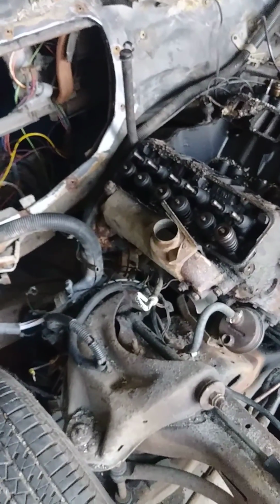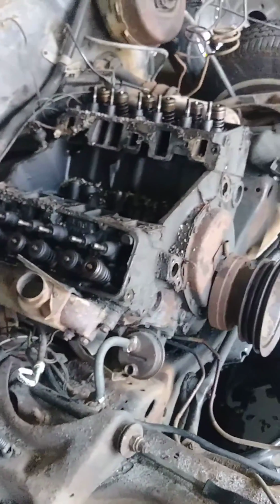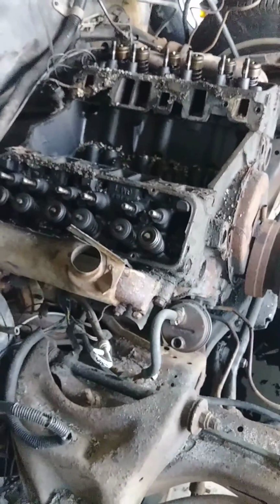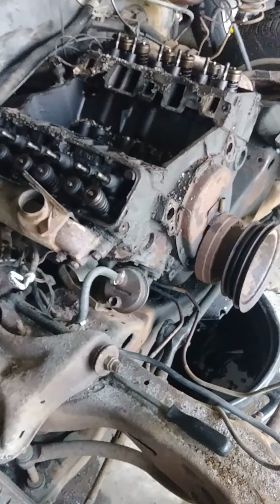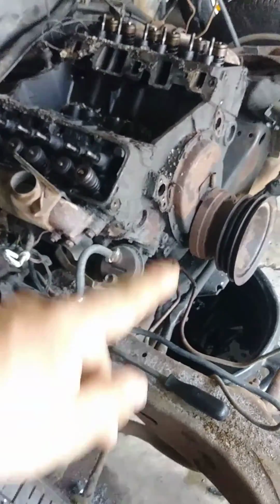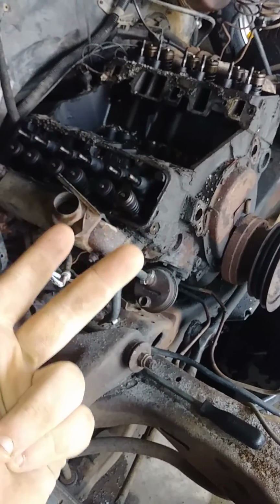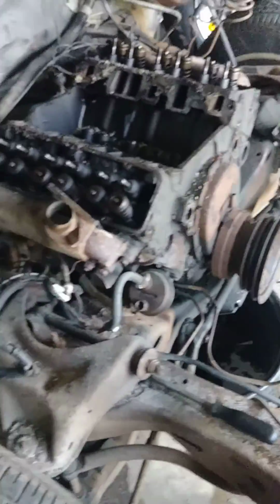And since I'm using that trans with the 350, the 350 ain't going to be getting the twin screw supercharger, by the way, off the bat, guys. It's just going to be built to the regular old block it is. By the way, I found a block yesterday through my work. Customer came in, we were talking about cars, told him about mine, what I planned on doing to it. I found a Vortec 350 block. That's what's going in here. You see this little V6 going bye-bye, Vortec 350 going in. I just gotta find pistons, cam, heads, oil pan, and all the other miscellaneous stuff, like timing chain cover and all that.